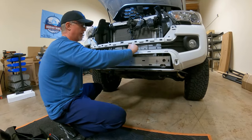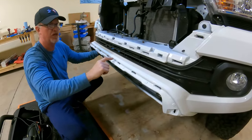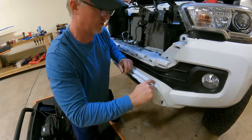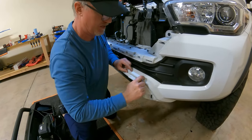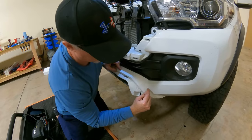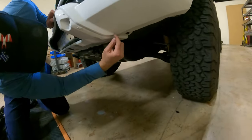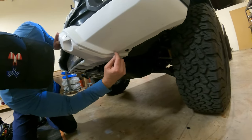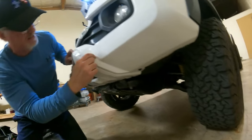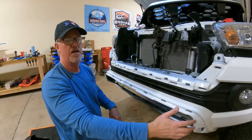The cut you're going to do is 3/4 of an inch from this edge. So give us a minute, we'll get this dialed in, and you're going to come down, 3/4 of an inch from this edge, and you're going to wrap into this corner, and you're going to come down this seam right here, all the way down the bottom, and then underneath here, you're going to come across and then cut down that seam. So you're going to come up like that here, then feed into your 3/4 of an inch mark that you put here and cut all this off.